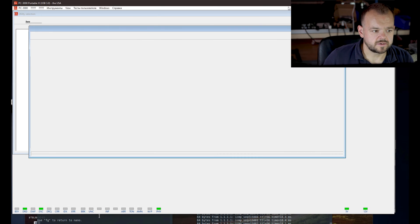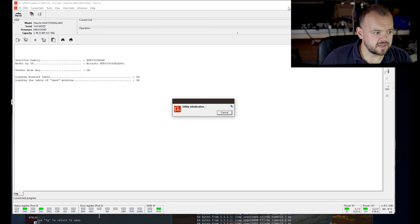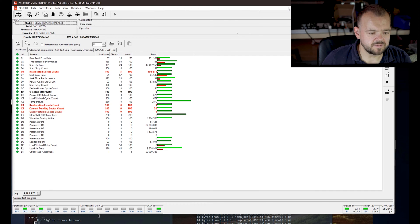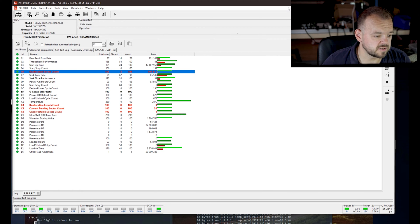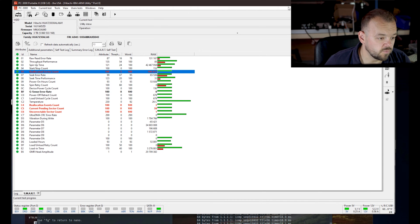We hit auto detect. I just want to check the SMART data on this drive. It's a Hitachi 3TB. SMART is not always accurate, but we're seeing some relocated sectors already, and then pending and current counts. So this drive is already hitting problems — it's got SMART issues, a relocated sector counter issue. This is why the client was getting emails from the unit complaining about the relocated sector.